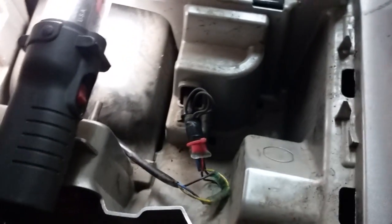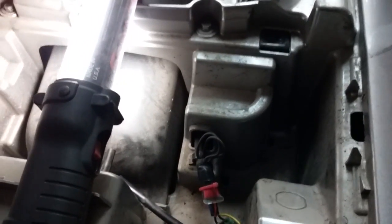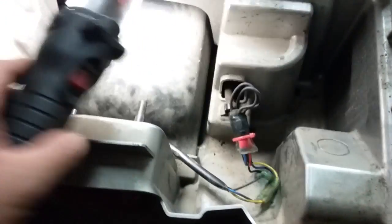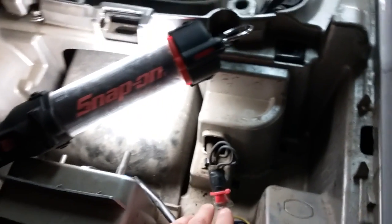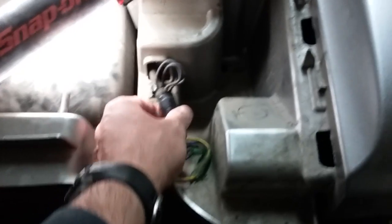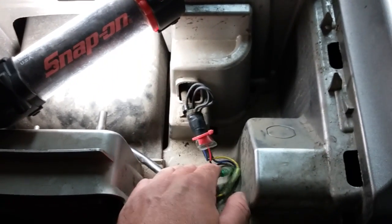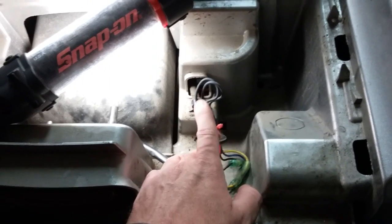But here's the thing, if you test everything else, the fuse, the relay, the fan itself, the thermal sensor, and you're still having an issue, it may be all the way back here, which Highlifter actually makes one for about $15, and I believe it's supposed to run the fan a little longer and not trip out so easily, but anyway, you can replace this, worst case scenario. Now, I'll show you real quick, if everything is working correctly, when you have the system jumped, everything's connected with a new solenoid, I should say a solenoid that works.